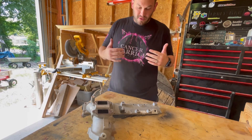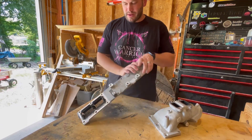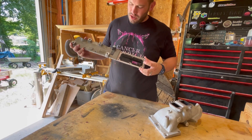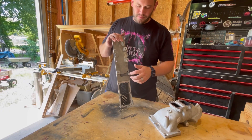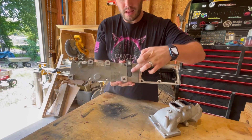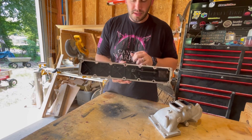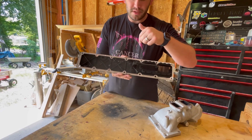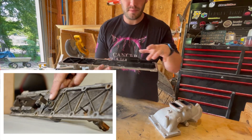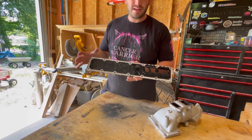What makes the Banks so much better? There are several things, but the one key thing that made me want to purchase and change out was the intake plate - this guy right here. This has been killing many Cummins engines out there, and what's causing it is the grid heater relay attachment position for the cable. It's a solid plastic piece; the cable bolts onto here with a stud, and on the reverse side there's a stud where the cable attaches.